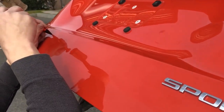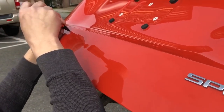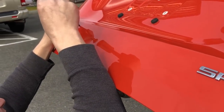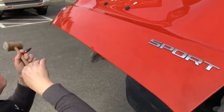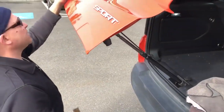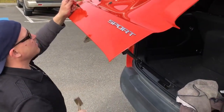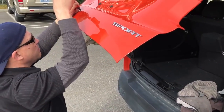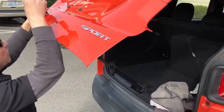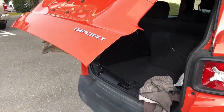Real in-depth stuff. I mean, if you just wanted to watch a dent come out, this is a little bit more than that on a video, because we're getting into some in-depth visualization and tapping. And this one does still have some crowns right up here from the initial dent, right down here, that I can come in and baby them out, straighten up this whole thing. The glue did a lot so far, and now let's do what we call cross-checking.